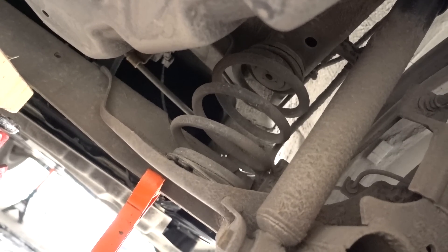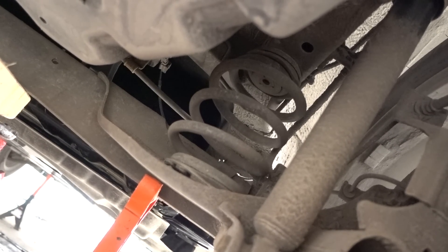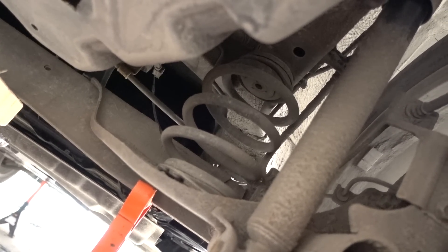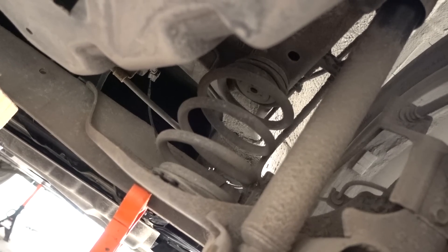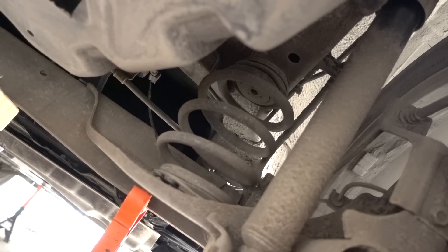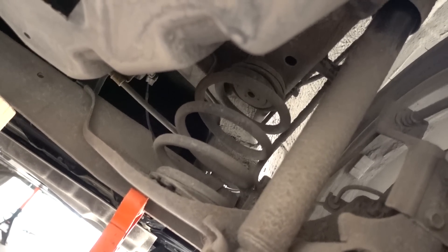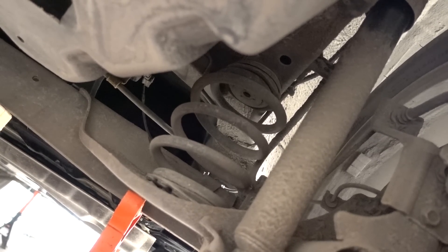I also put some undercoating here and some spray to keep it from rusting out. Speaking about things that need to be changed — the rear springs must be changed when doing this upgrade because you add so much weight to the car. This will be done at a later stage since I didn't have time to order these springs, but the customer will retrofit these afterwards. I'll put the part numbers in the description so that you following along at home can order these in advance.